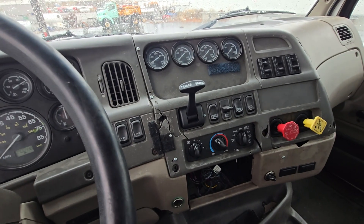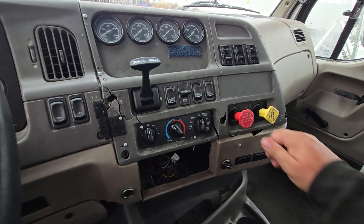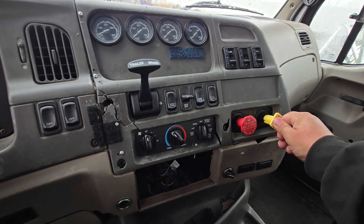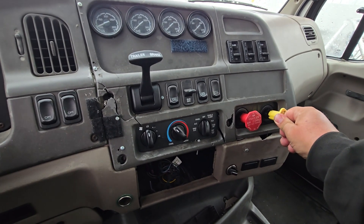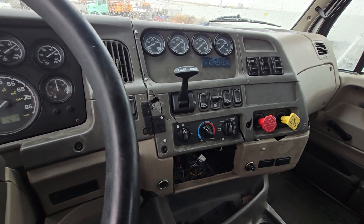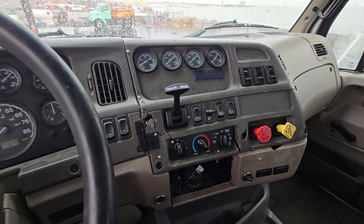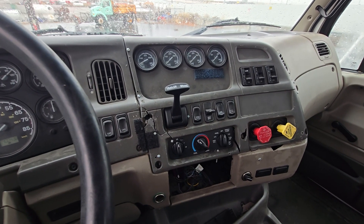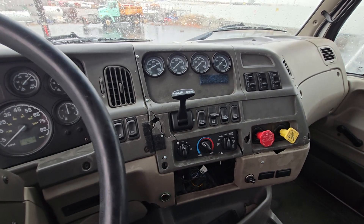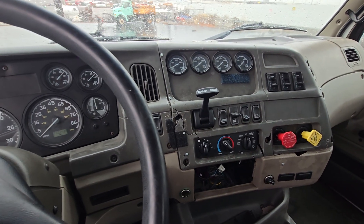Next, I'm going to release my trailer and parking brakes — my wheels are chocked. I'm going to release the trailer and parking brake to make sure that when we build up the air pressure and the governor cuts out, we are at full air pressure and we're not losing a whole lot of pressure when we start our air leakage rate test.